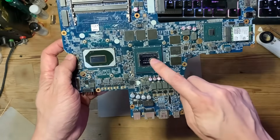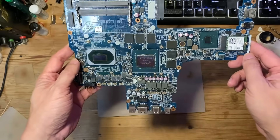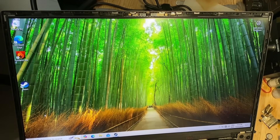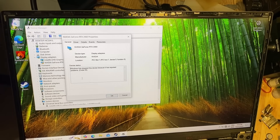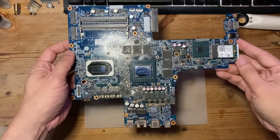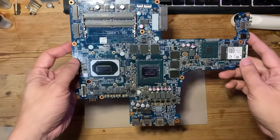I have not yet replaced the graphics chip because I was just hoping that maybe this is one of those rare occasions where it survives. Unfortunately, as I'm about to show you, it did not. If we look into the Device Manager we can see the RTX 2060 showing up with a yellow warning sign. We click that and we see the much dreaded error code 43. This could mean a lot of things but in this case we can be pretty certain it's down to the hardware damage explained earlier. With right click on the desktop, we do not see the Nvidia control panel showing up. So there's only one thing left to do and that is to replace the graphics core chip, which is what I'm going to attempt today.